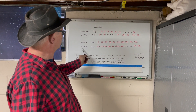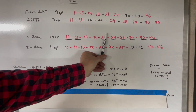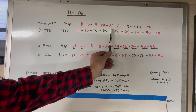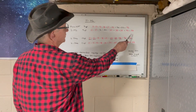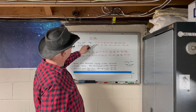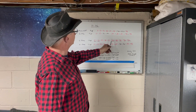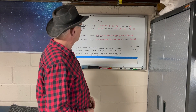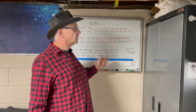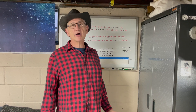Look at the Z-Race 10-speed and Z-Race 11-speed — they basically overlap all the way up. 10-speed and 11-speed, you're just losing one gear, but the ratios are not very much different: 40-46, 34-34, 28-28, 24-24, 11-11, 13-13. The 15-to-24 range just has an extra gear in the middle. That little bit wider spacing sometimes is better — when you're riding around in the woods, you don't have to shift as much. I did it basically because it's what I had for parts, but there's a real valid reason for thinking about running a 9-speed, just for the wider ratio.